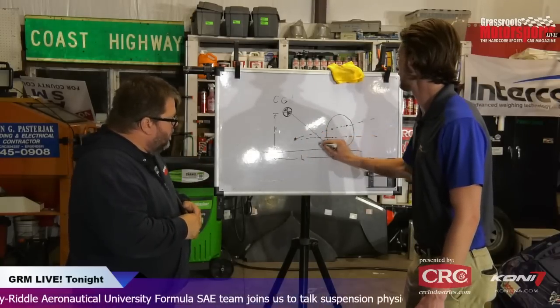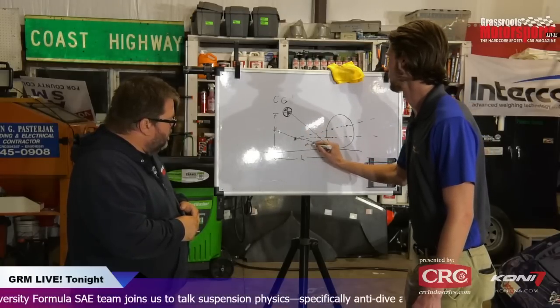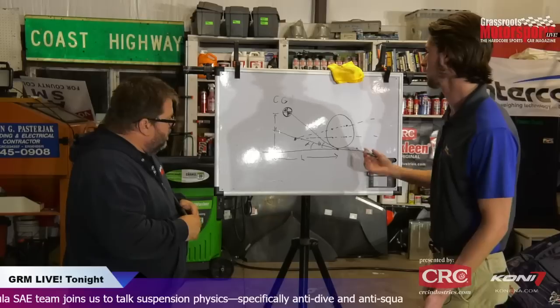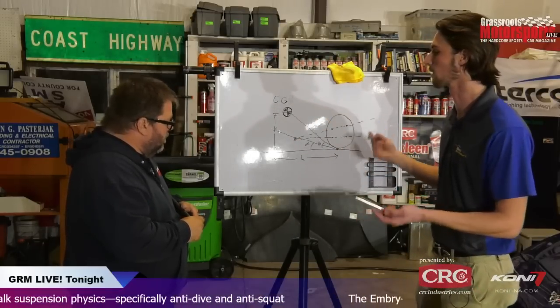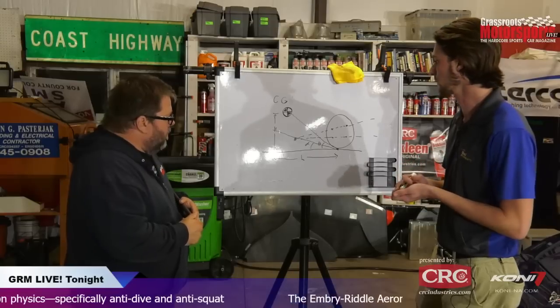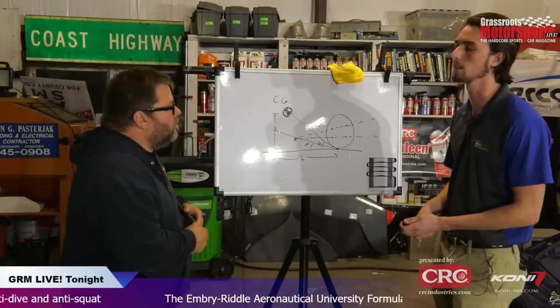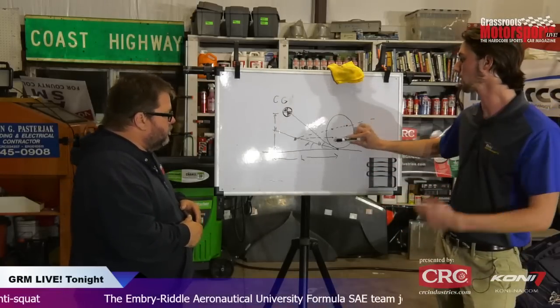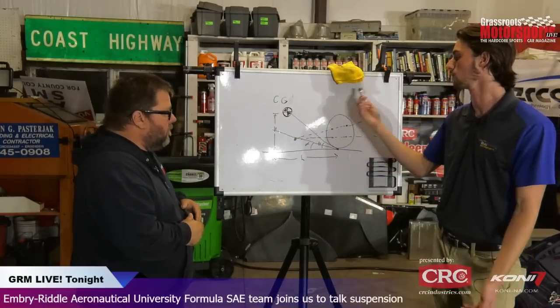And then that angle, which you could call alpha maybe, and depending on what that is, the tangent of that over the h over l, right? So that would give you your percentage. So again, same thing, if you had this directly at the CG, that's 100%. If they're parallel, then that's at infinity. It's not intersecting anywhere, so you'd have zero.